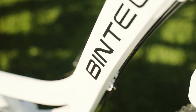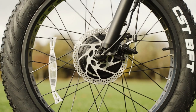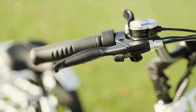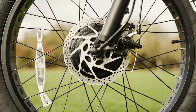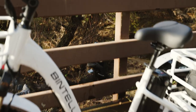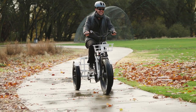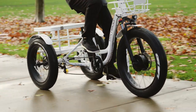Now, let's talk about brakes. We've got mechanical disc brakes with 160-millimeter rotors, both on the front and rear wheels. On a bike this size going these speeds, we'd like to see hydraulic disc brakes, and maybe that's an upgrade we can see in future models. Of course, with hydraulic brakes, we would lose the locking functionality on the mechanical brake levers, which is awesome for keeping the Trio locked in place when parked on an incline. Still, while the brakes did fine and worked as intended, we'd love to see hydraulic brakes on e-bikes — they would offer more stopping power and would also require less hand pressure to bring the trike to a halt.